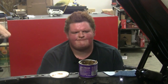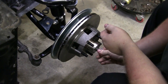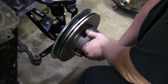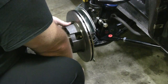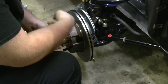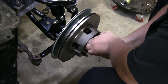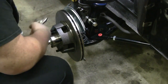Now for the nut. Put the washer on your castellated nut. Now I have an adjustable wrench — I'm going to use that to seat the bearings. Spin the hub, tighten them down. It's pretty much a feel-as-you-go procedure in my opinion. That's fully seated — they're good and tight. Now I back off half a turn, spin it, tighten it by hand. Once you can't go any further with your fingers, go a little bit past with the wrench since these are new bearings — they will break in and that will give them end play.